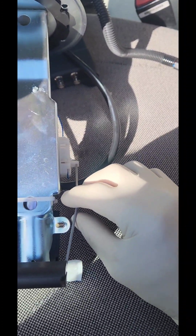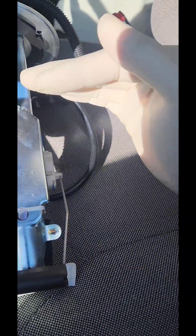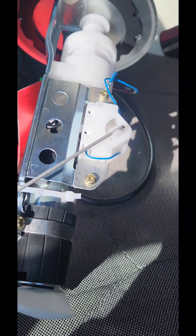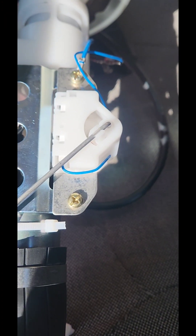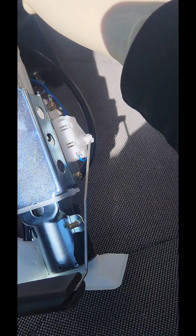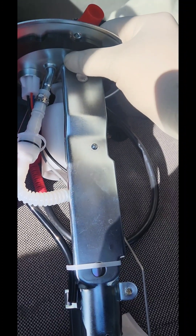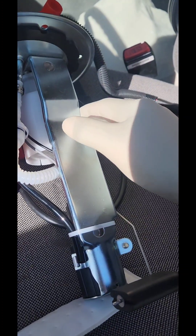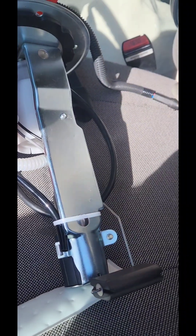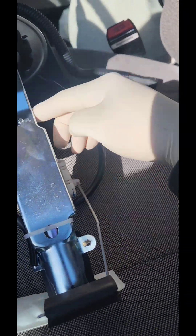This is the new pump — this is the fuel level sensor. This piece shows you how much fuel you've got in the tank. What happens is this thing goes bad over time. The plastic resistive strip inside gets degraded by gasoline, and these things are not made with great quality, so they might last only a couple more years. This is the brand new one, and these are pretty expensive. It's not the cost of the part that's painful — it's dropping the fuel tank that's a pain. On this van, there's so much stuff that it's easier to take the whole tank down.